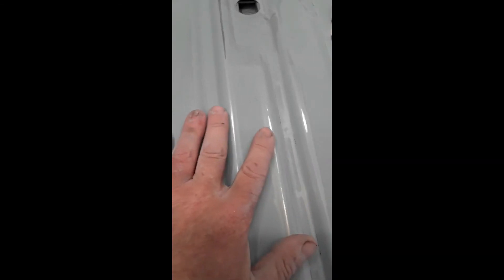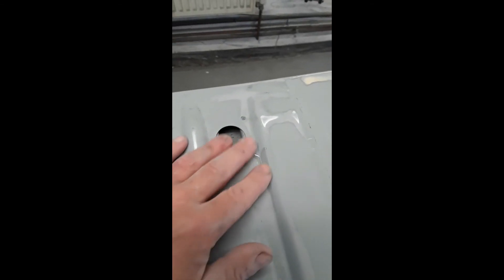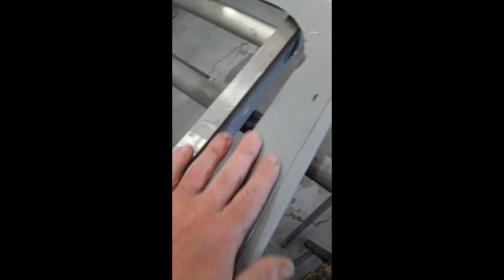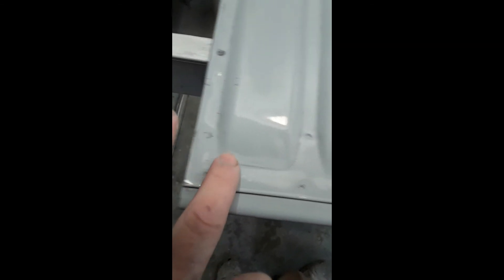You don't really have to go to all this guide coat flatting when you — if you like me just grab it and spray it — the better you can get it to start with, the better the result will be. I suppose that goes for the professionals too. But if you have to flat back to get a polish or get some dust out, if you've got any furry bits that you haven't sanded back, you'll never ever get them out — you end up trying to polish out imperfections from the top coat that are actually down in the primer.